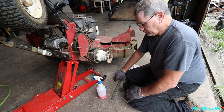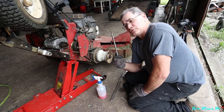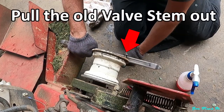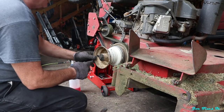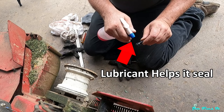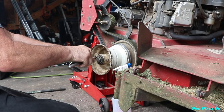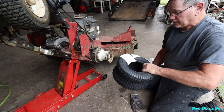While we're at it, I'm going to go ahead and replace the valve stem since I have it off and it's easy to get to. I usually get one of these little valve stem tools at Harbor Freight — I'm not really a big fan of Harbor Freight but that's where I bought this and it works pretty good. If it tears it in half when it comes out, that means it's rotten. Let's get the rest of this valve stem out. I have a little lubricant here — I bought it on Amazon, but you can use dishwashing detergent, it works just as good. Stick it through the hole, use your valve stem tool — you don't even need this, you could do it with a regular valve core tool — and just pull it till it pops.